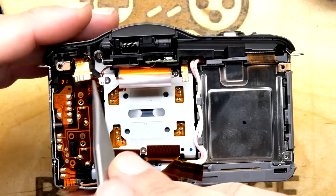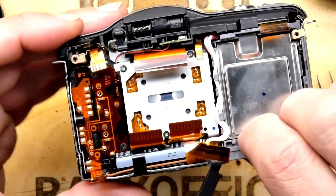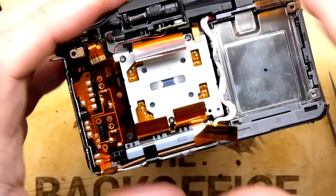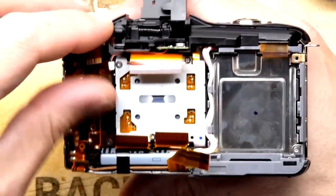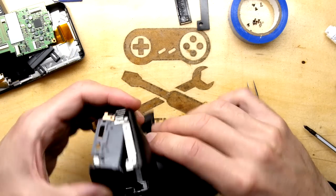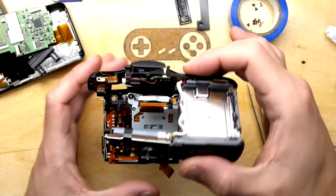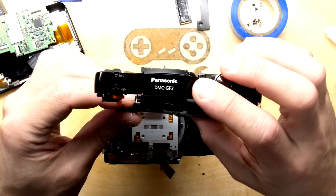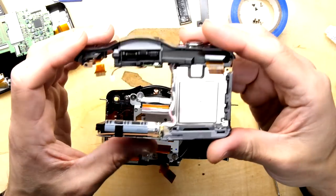To cut a long story short, the lens mechanism we're aiming at is at that level - there'll be probably four screws holding that lens in, so we need to get more and more of this camera apart. I'm going to shut the battery bay door - I don't really want that to go wrong. There's already a little crack on mine here. Just working out what you need to unscrew could be the tricky part. I can see a 300V, 85 microfarad capacitor for the flash charging circuit.